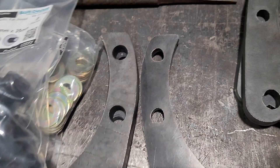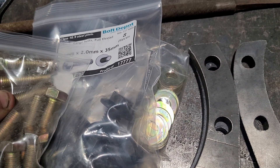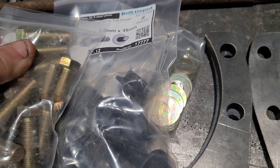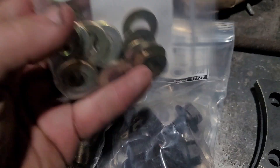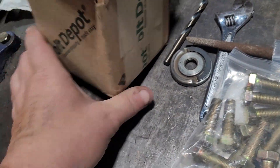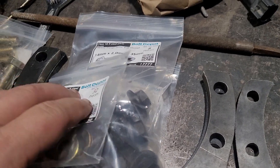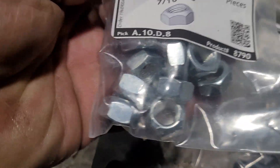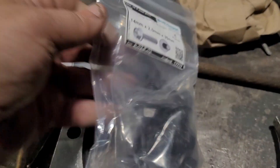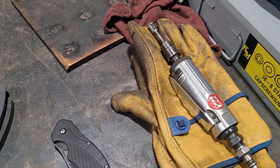The kit that came from Boyce didn't have washers, and I'm not a fan of using hardened steel nuts and bolts rubbing against mild steel because these trucks vibrate a lot, and I would rather have a hardened washer in place. That was from Bolt Depot — it was 50 bucks plus about 13 bucks shipping, so 63 bucks for everything. They're all grade eight — the nuts, the washers — and the flange bolts are 10.9 hardness, basically the metric equivalent to grade eight. So I'm going to get to zip zipping. I'll catch you later.